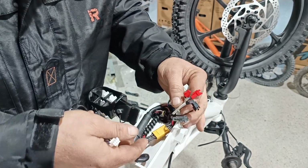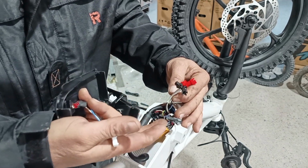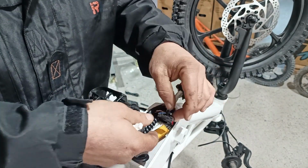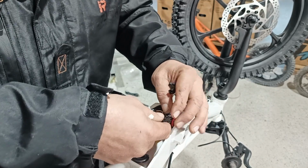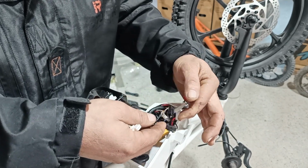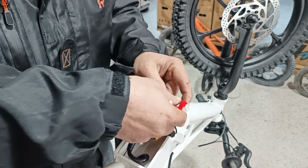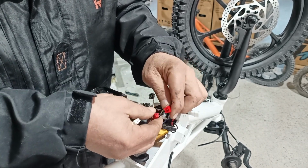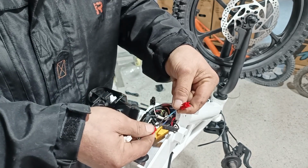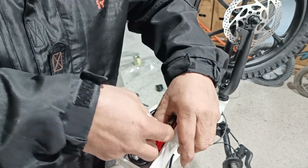These wires are your mode wires. This wire here is 24/36. If it is connected, it is 36 volt. If it is disconnected, it is 24 volts. So I know I have a 36 volt battery in here. I must connect it. This is speed limit or power limit. This is 50% power. This is 100% power. This is kickstart for 12-inch models. Sometimes you use it on a 16, very rarely. Those stay disconnected if you want full power. Disconnected for full power, disconnected for no kickstart.